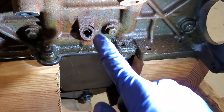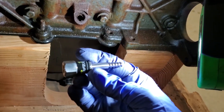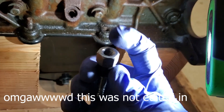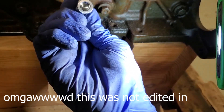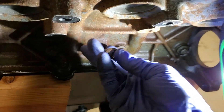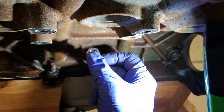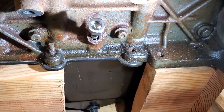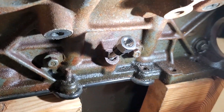This is what it looks like. We can also put a slide hammer on it, but you can imagine if it was in the vehicle you don't really have any room to put a slide hammer. So we're going to go ahead and screw that in and we're going to remove this broken oil dipstick tube.